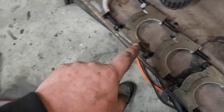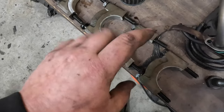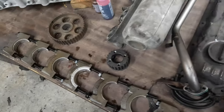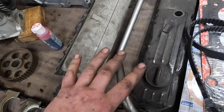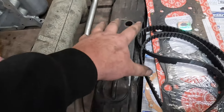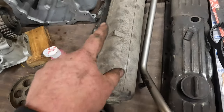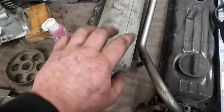I didn't even take the main bearings out of the block. Again, if you watched my last video, all the measurements and clearances were good — everything is round and the size that it should be. The intake manifold and the cam cover I have not cleaned up yet. Cam cover, because I don't know how I'm going to go about the PCV system — might have to modify this. I know I'm going to have to modify the intake manifold because I'll be doing an intercooler. We'll get to that later.